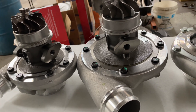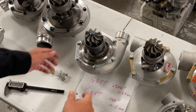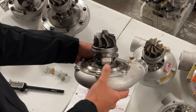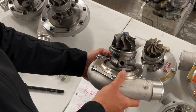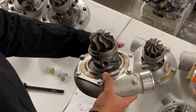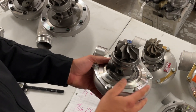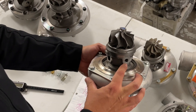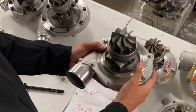Now we're going to take a look at some of the ball bearing options. The first one is your GT ball bearing assembly. Whether you've got the original GT — like the old GT30s or GT35s — or a new GTX or GTX Gen 2, the bearing housing assembly is going to look exactly the same. You've got your oil feed port, your water port on the side, and your smaller two-bolt drain flange.